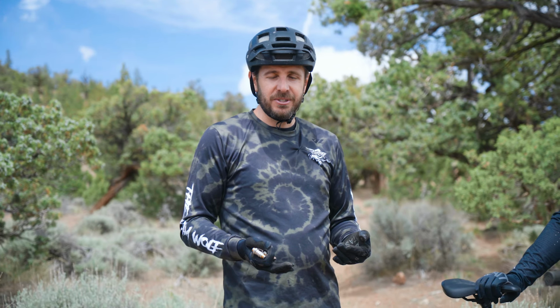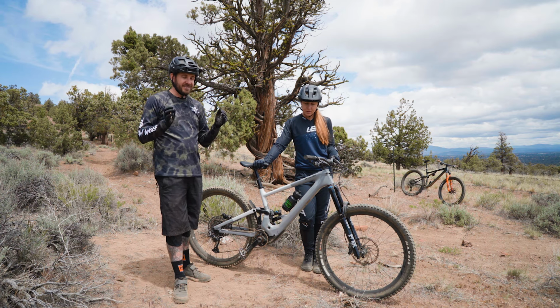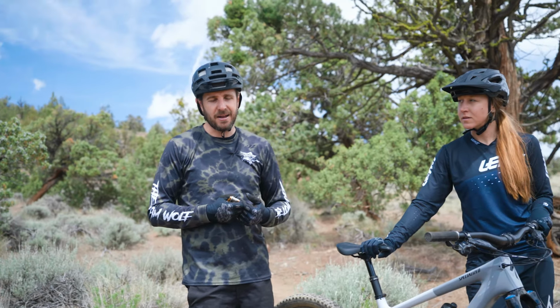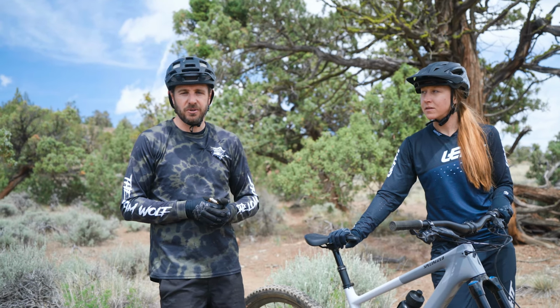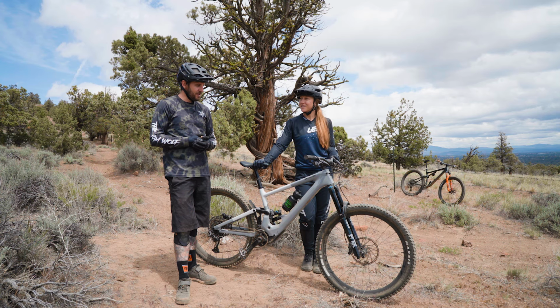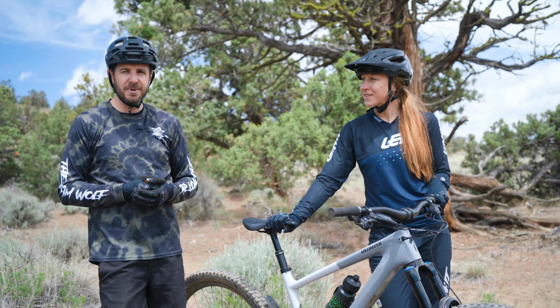After you've got that rotor centered, you know, there's only so much you can do out on the trail, but chances are with centering that rotor, backing out the pad adjustment, you should be able to get back out on the trail and at least finish your ride and make it back home to do the repairs you need. That should handle pretty much any noisy, creaky, misshifting, brake chirping issue you might deal with.